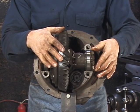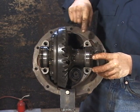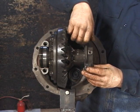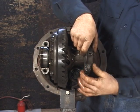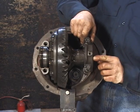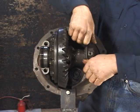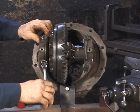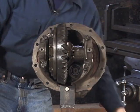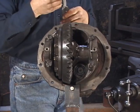Now we can install the bearing caps and retaining bolts. We've lubricated the bolts with oil. Match up the caps left and right from the punch marks we originally used. Hold the cap back off the bearing and just get the bolt started—this will align the cap to the threads of the adjuster. The cap should go down to the parting line in the case without binding. If it does bind, you're cross-threaded on the adjusting nut; reset the cap until it goes down flush without any effort. Then snug up the bolt and install the other cap. Using a spanner wrench or equivalent, just make sure that our adjusters turn freely. This will ensure that we haven't cross-threaded the adjusters.